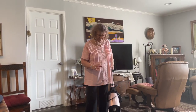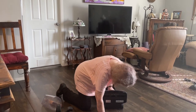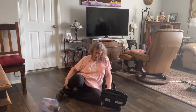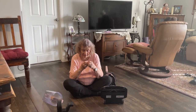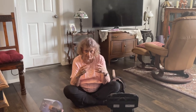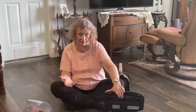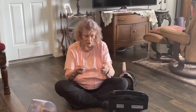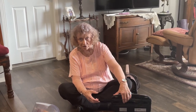So let me start with the first thing. With a lot of vacuums, if the rollers get hairy and they don't roll anymore because they're clogged and you need to comb them out, then the brushes don't move. That happened to my vacuum — the brushes were all stiff and weren't moving. You can use a comb or a little pair of scissors, cut some of the hair, and take out all the clogs. Then the brushes will start moving again.